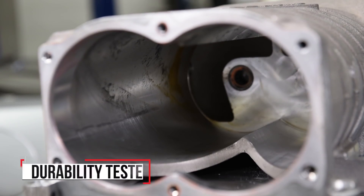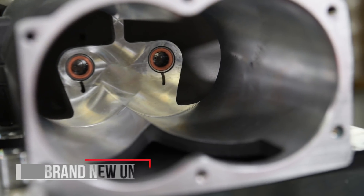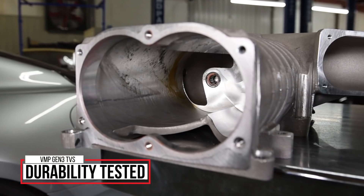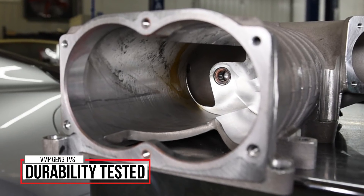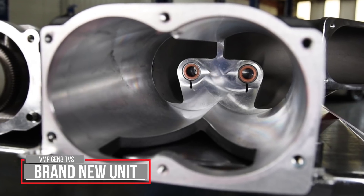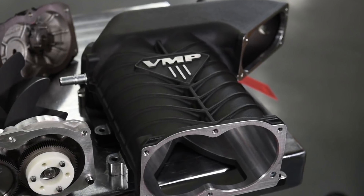When we take a look inside the supercharger housing, we really don't see much of anything — just a little bit of dirt and dust that built up on the walls. Basically, if this was run on a car, you'd be seeing a little bit of oil from the PCV system getting flung around inside the rotor bores and making some very light marks or patterns on the supercharger housing. You're always going to see more towards the top of the supercharger housing because as the rotors build pressure at the outlet, they get forced up into the roof area. All the ribbing on the outside looks cool, but it's really meant to reinforce the ceiling of the supercharger housing and keep it from flexing under boost.